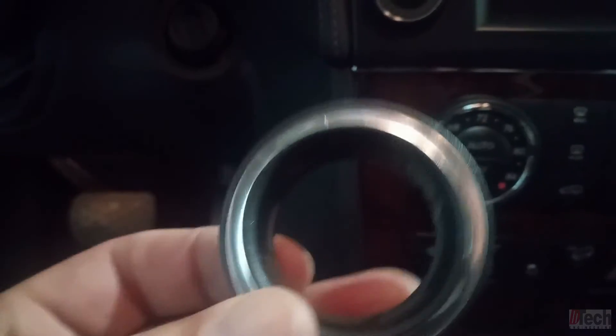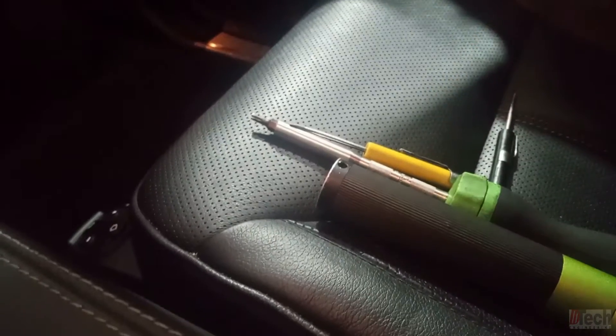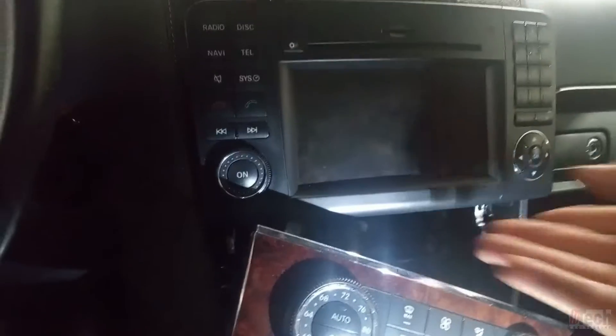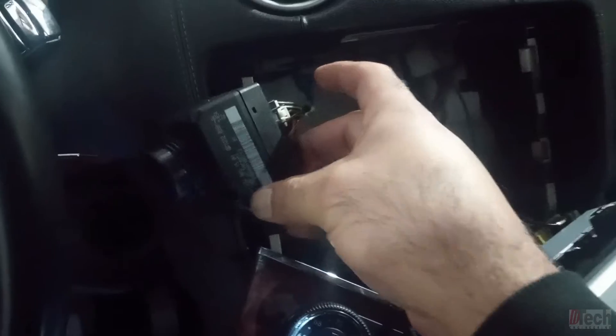In doing so, there's a ring you have to remove — you turn it counterclockwise. I just use two pocket screwdrivers, fed them in there, turn it and that'll pop off. Then you have to remove the console and radio unit to reach in there and pull it out. First you remove the ashtray at the bottom, then you pop out this panel, and over here there's a screw there and one there. After you get those out, you just slide that down, pop out the radio unit, reach in there, pull out the ignition box and unplug it.